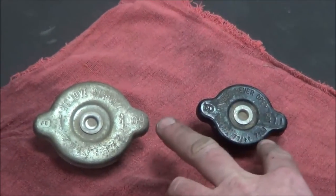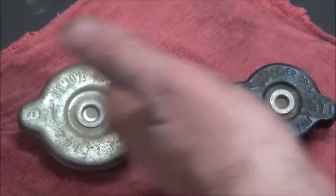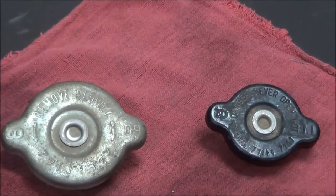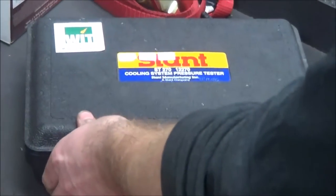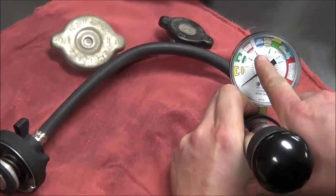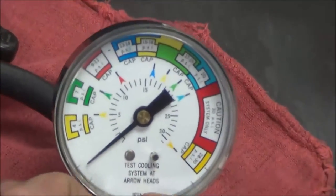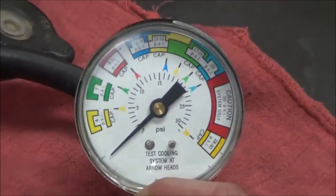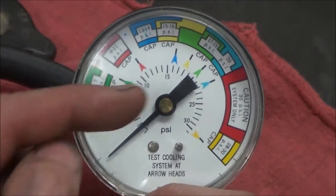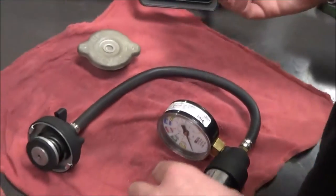All our tools and ratings are going to be in American psi because that's what we can relate to. Radiator caps have an intentional pressure value. This is a Stant tool — most popular — an automotive tool with motorcycle and small radiator cap applications. Looking in here you can see ratings of 9 to 11 psi, 13 to 14, 15 to 16, and so on. We're going to be able to pressure test caps and radiators to see if they hold their design pressure.